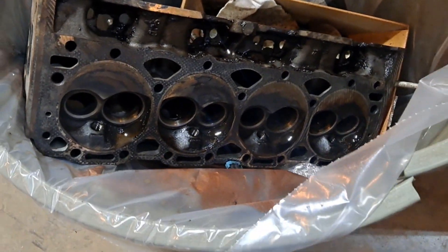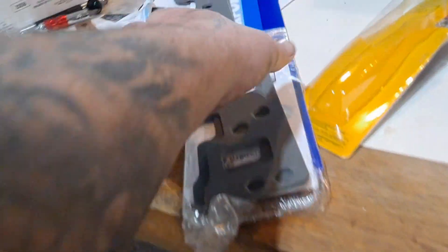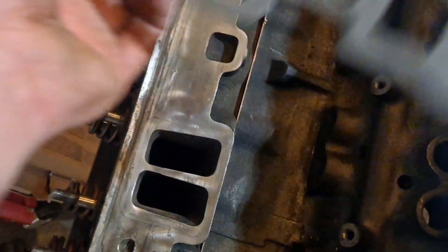I've got to go over here and start putting valves in on this head. I'll get the air gun out and blow it into the trash can, then take it over and start putting valves in to get it set up. I bought the intake gaskets — they're for the 350, the older ones or the Vortec — so they're dual purpose basically. Fel-Pro part number 1255, intake gaskets for small block Vortec, for carbureted intakes. I think I have this one upside down and backwards — yeah, that's upside down and backwards.